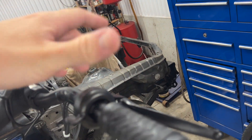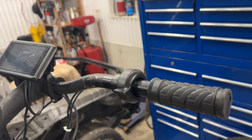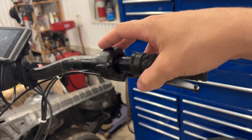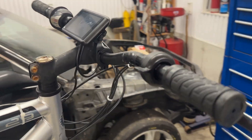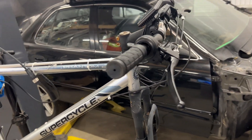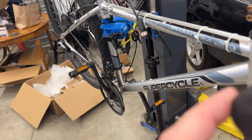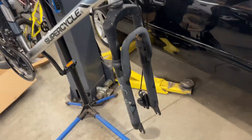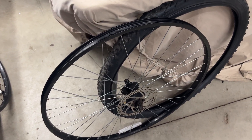We are going to have a six or seven speed thumb shifter over here. The thumb shifters are nice because they stay out of the way of the controls. They're the really cheap Shimano thumb shifters — some of the cheapest shifters you can get — but they do the trick for the amount of gear changing you need to do. We're going to put a different front wheel on. This front wheel has a bunch of broken spokes and it's single wall, so it's kind of like tin foil. You don't want that.